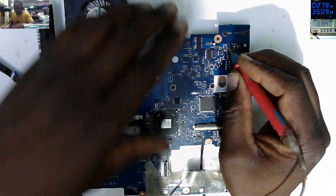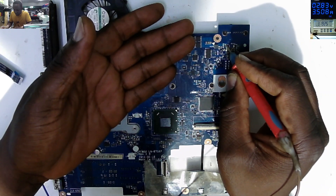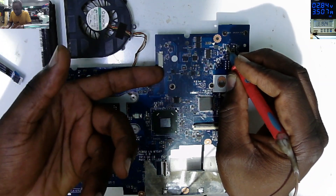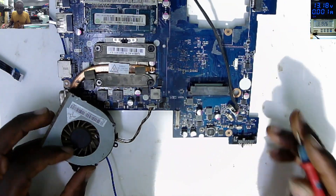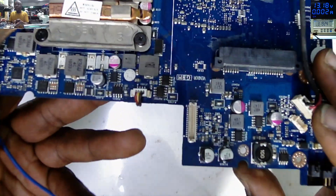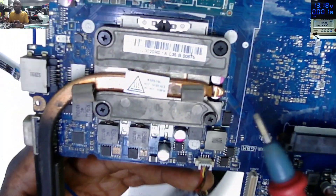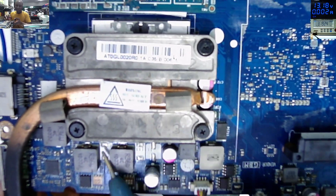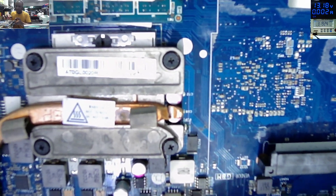Raising to 3.5 amps - something here, but on the other side. What is on the other side here? We have a power supply for the processor and the graphics - the graphic chip is inside the processor. So we have coils and MOSFETs, and something is wrong here.